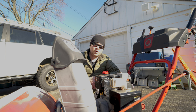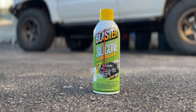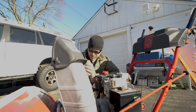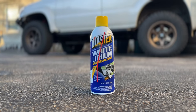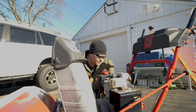Lastly, before calling it quits and getting everything ready for the season, I like to spray down the chute with a silicone spray to help lubricate it. If you've ever done slushy snow and had it bog up and stick down there, this just helps it eject better. And then I'll use some white lithium grease on the various cables and joints — anything that moves. White lithium grease is extremely waterproof, extremely temperature-proof, and it's a great thing to have to lube up the moving parts on your snowblower.